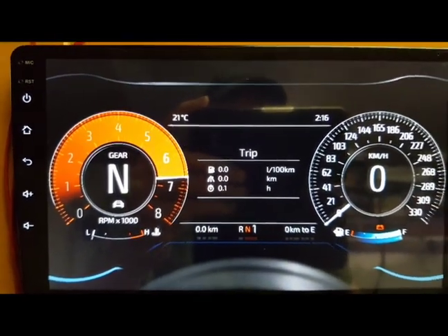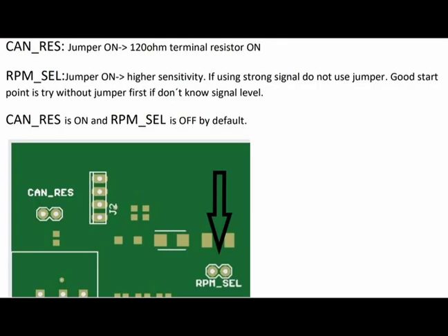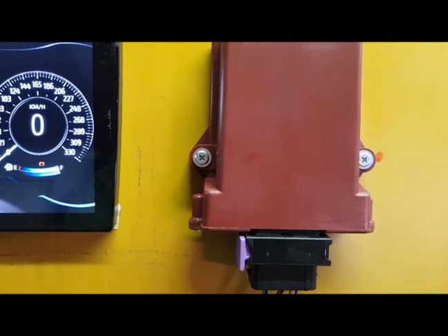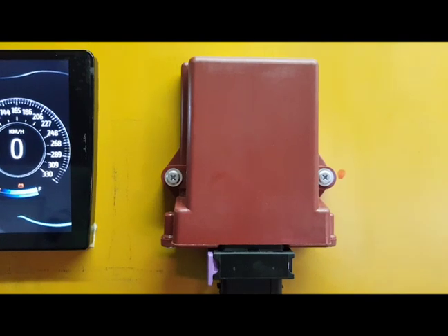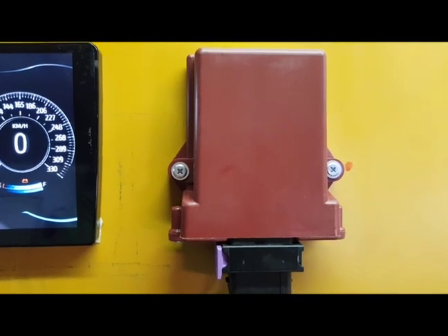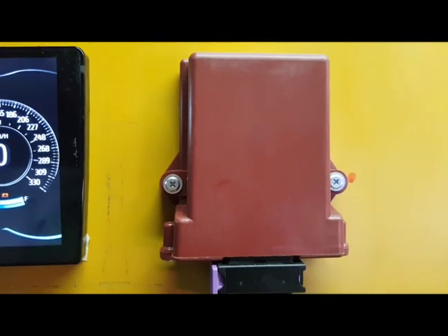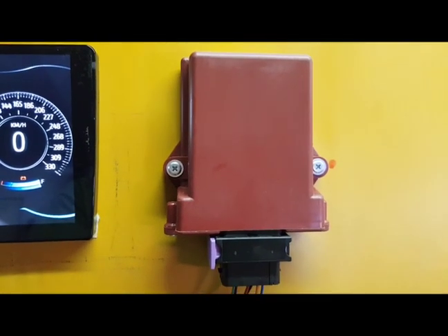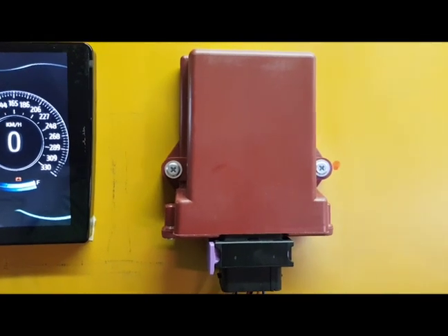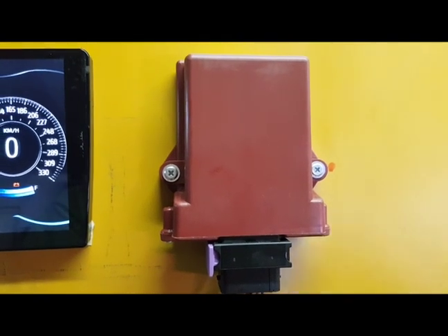So this is how the RPM is connected. There is inside the dashbox one jumper that you need to make sure is in the right place, because it can adjust how strong a signal you have. If you have a very weak signal, like from a hall sensor or ECU signal, then you can use the setting for the weak signal. If you have a stronger signal, then you need to remove the jumper because it will give too much power to the measuring circuit.